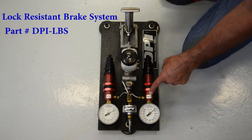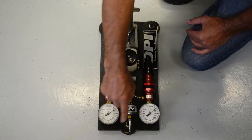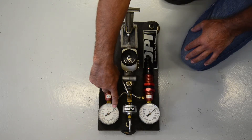This is going to be your front brake pressure, so your front calipers. And this here will be your rear calipers. And this is what the gauge is showing. The purpose of this tester is to show you how this valve just delays the rear brakes momentarily.